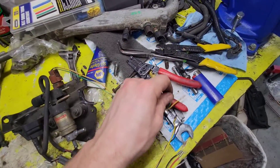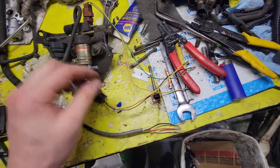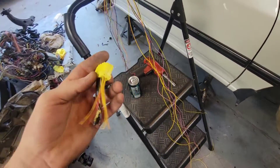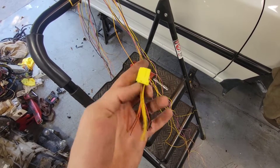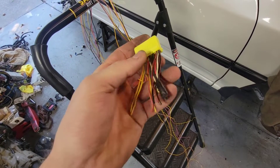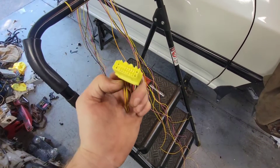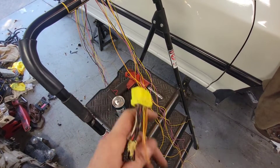Okay, I got all my wires stripped back and some connectors crimped on. Now I'm going to put this back in the car and we can start making the actual harness to run inside. As far as the harness goes, I'm going to use the wire from that other harness — this is a first-gen ECU connector that has the right style of pins. I'll take these pins out and barrel-connect them onto the wires here so I can plug the pins directly into the ECU in the spots we need.